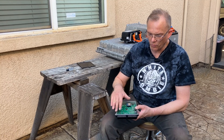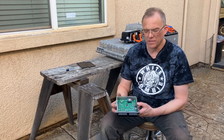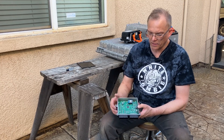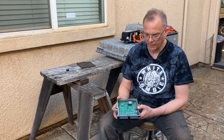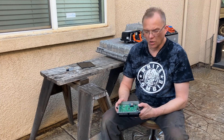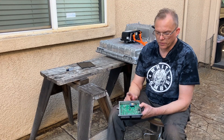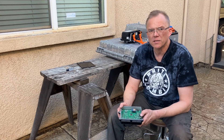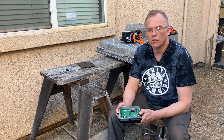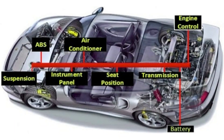Don't be intimidated by the 56 pins — I can't think of any application that will require you to use all of them. Because it's designed for multiple different vehicles, different vehicles will require different pins, different pinouts. It's very unlikely that you will wire every single pin. To control that safety box, all we need is just two pins from this connector. We talk from this controller — this brain module — to the safety box over something called CAN bus, or CAN. CAN stands for controller area network. It's comparable to LAN or WAN — local area network, wide area network — and I call it car area network.